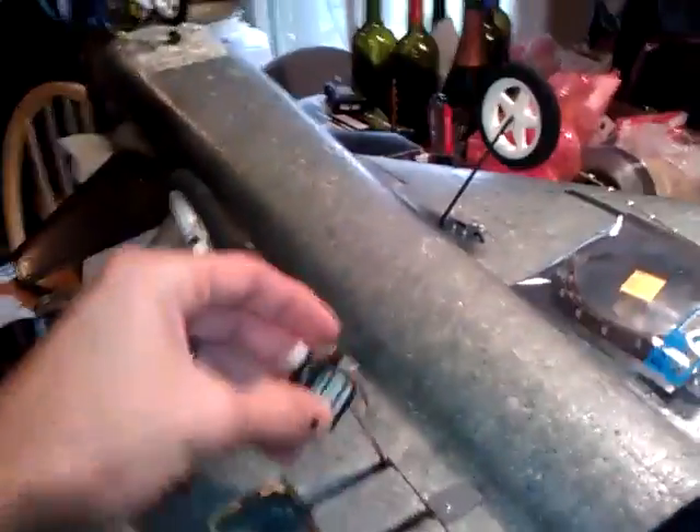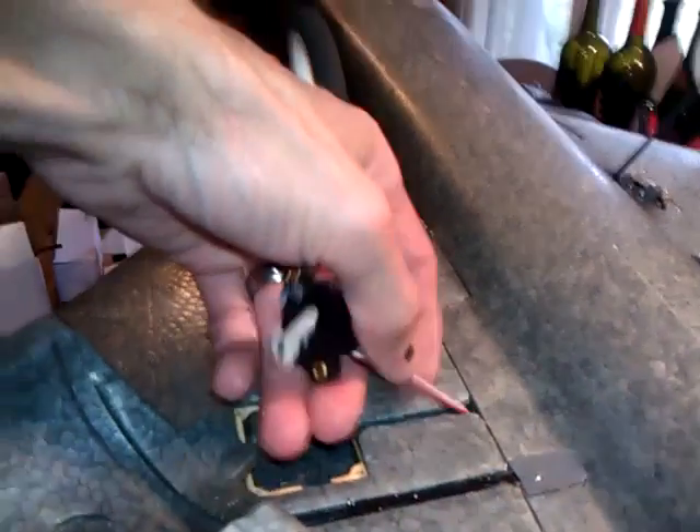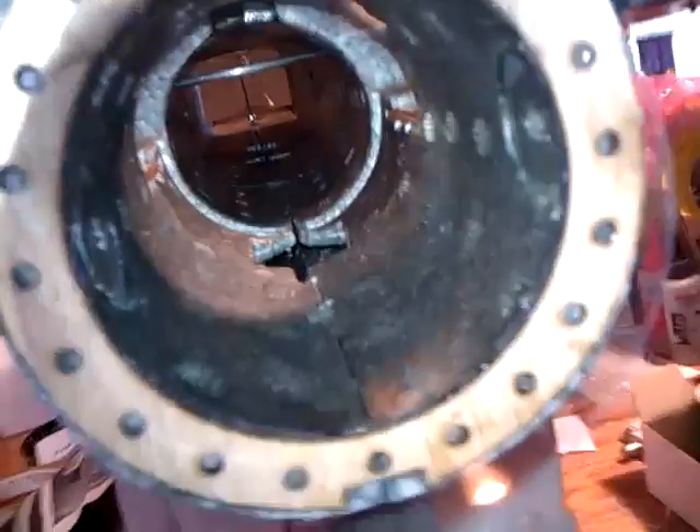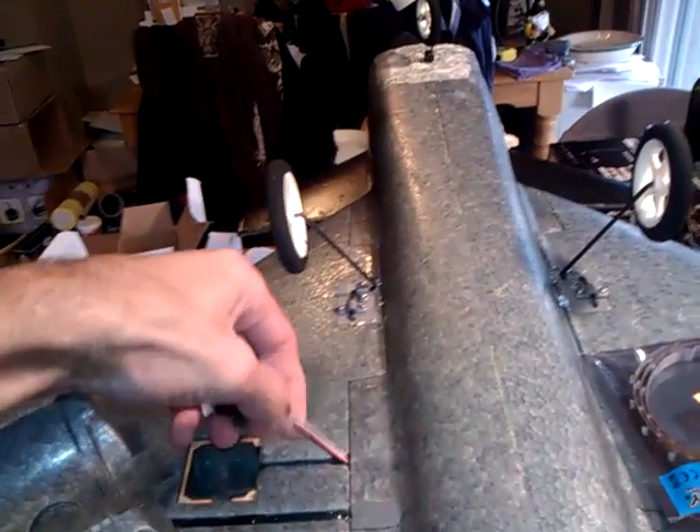While I've got it upside down, I'm going to go ahead and put in my new digital servo. I'm going to cut these leads about right here and solder in - I'm not going to pull these leads out, they're a pain. They're actually inside the tube, way in there in this little ring on the sidewall, and it is a pain to get that wire out. I solder and cut and reverse servos all the time, it's not a big deal. I've got a bunch of extra plugs left over, so I'm just going to put a plug on there so that at any time if I ever need to change out the servos, I'll just be able to unplug it and pop another one in.